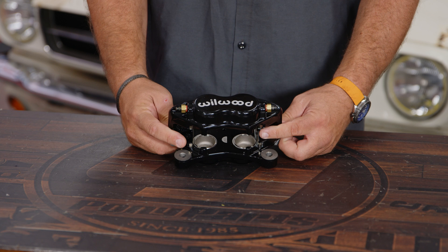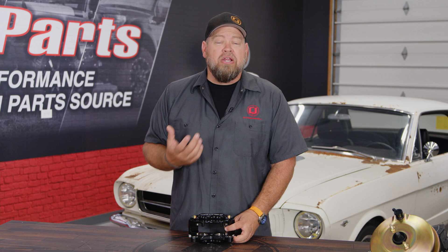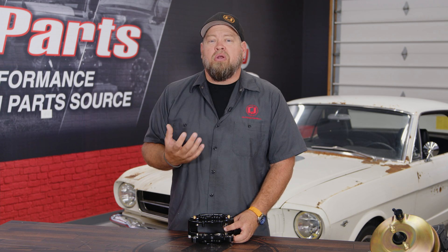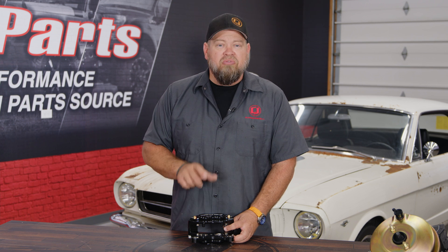When the fluid reaches the caliper, the caliper creates pressure on both sides, and the pistons inside actually move, which moves the brake pad, which creates friction against the rotor and stops your car. In the master cylinder, the rod moves a significant amount to start moving the fluid because it's moving to four locations. Once it reaches the caliper, the pistons actually barely move. That's why when you put your calipers on, your brake pads are all but touching the rotors — these just move a small amount when the fluid is applied to stop your vehicle.